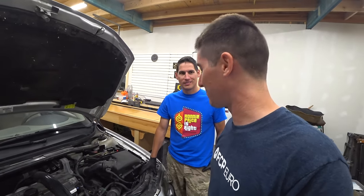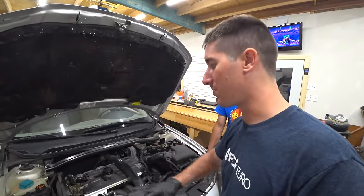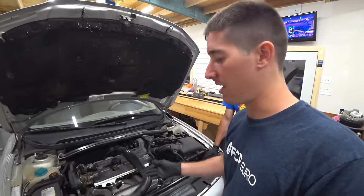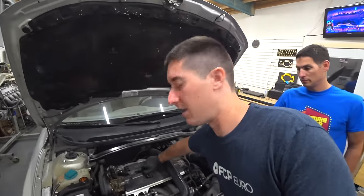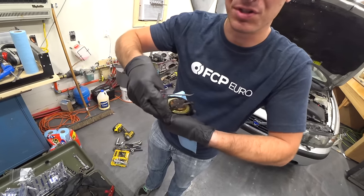They still have the little studs on them — less than 50 miles. So the root of the problem here: the PCV system gets all carboned up, clogs up, and there's a bunch of crankcase pressure and it blows the cam seals out. So we're going to do the cam seals, but first we have to knock out the PCV. Also, the comments said to replace the oil cap gasket because it leaks. And guess what? It leaks. I got an oil cap gasket — I do read the comments.